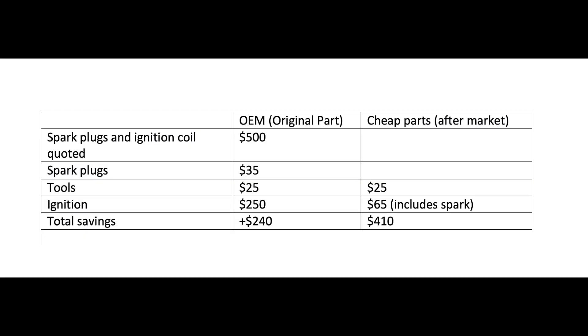I have a few options to consider. If you're going to keep your car long term, go with OEM — the original part that came with the car. Those are the best quality and last a long time. Spark plugs range from 60,000 to 100,000 miles, so buy the one that's right for you. The higher the quality, the longer it lasts, and the more expensive it gets. I'll go with the most expensive because I plan to keep this car for my sister. I also went OEM on the ignition coil since I'm saving on labor.